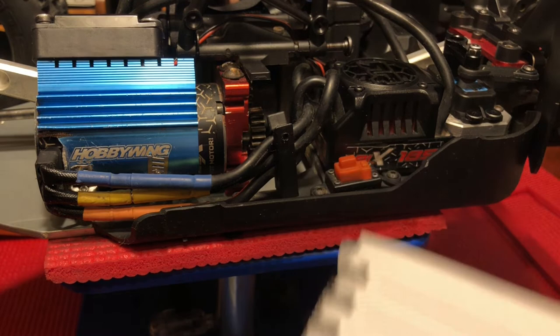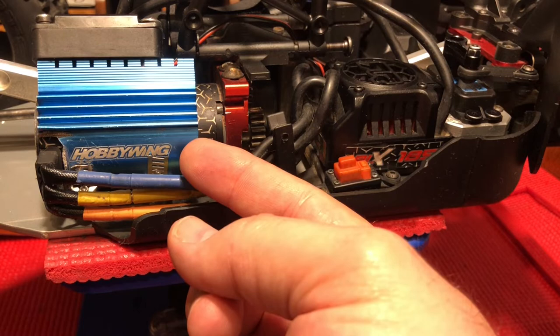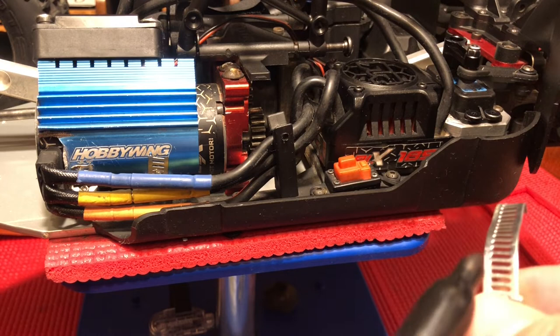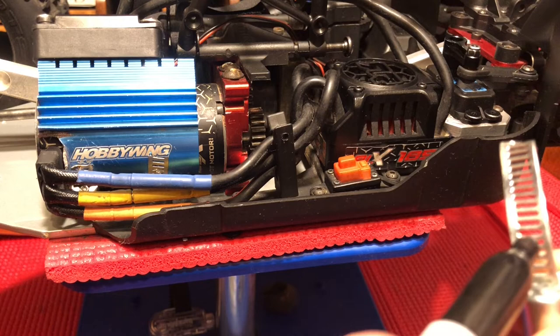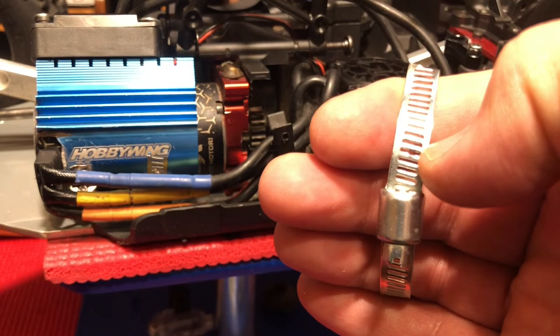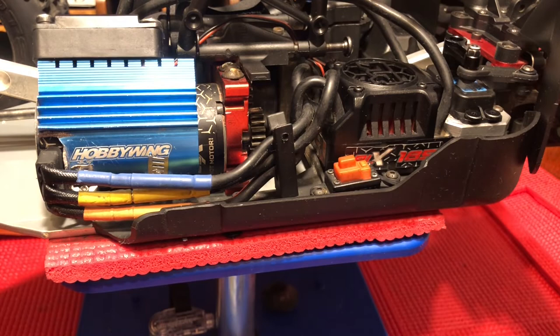So that's how I installed this. What's nice is once you get the four holes drilled into the heat sink — and like I said, it was easier for me to pre-drill little holes with a drill right there, because otherwise you're just trying to force feed it through that little wedge and it's difficult. So pre-drilling little holes made it easier. Then once you start tightening down these screws with both hose clamps on, it just sucks the heat sink right over the motor, tightens it up real tight, and you're good to go.